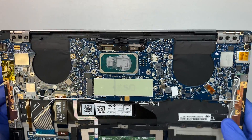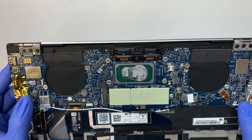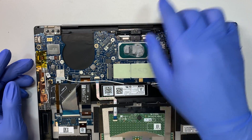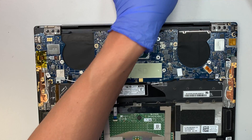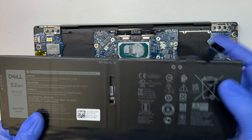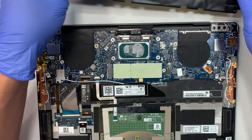You're going to ask if there's a CMOS battery — you do not see one here. On modern computers, the CMOS runs off the main battery, the big one. If you remove or disconnect the cable long enough, it will reset the BIOS or the motherboard.